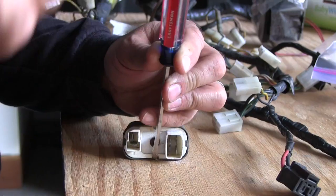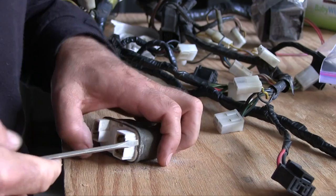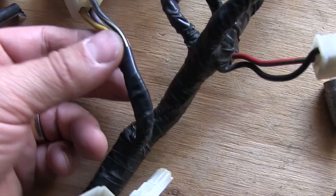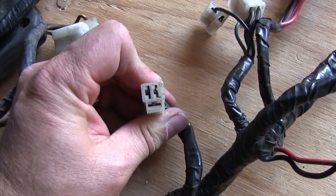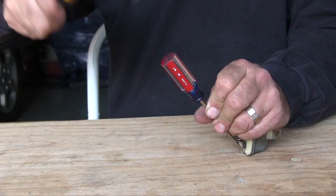I'm removing all the relays — I want to plate all the cases. You don't really want to pry the tangs if you can avoid it. Use a screwdriver and a hammer to flatten them out. The base is plastic and fairly brittle. The ignition relay goes on a three-spot with yellow with black, black with white, and blue with red. Ignition relay coming apart — it's fragile plastic on the bottom, so if I can avoid prying against it, that's best.